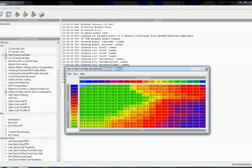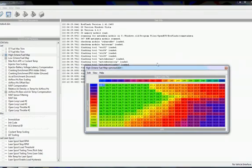What the fuel map represents is how much fuel the ECU will add, depending on where you are on the RPM scale and where you are on the load scale. Now on a more basic level, before we get into the tuning aspect, understand that EcuFlash doesn't store, or I should say, the Evo ECU doesn't store these actual values as you see them in the ROM image file. It stores other numbers that represent these by way of a scaling.